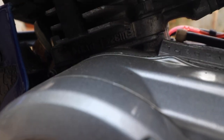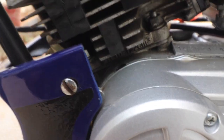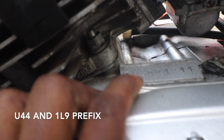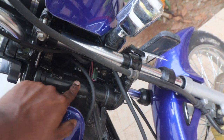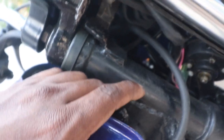To check if it's a converted bike or an original bike, the engine number for an original five-speed bike will start with 1E5 and I think 04-4 — those are the two codes that would confirm it is an original five-speed. Make sure this engine number matches the chassis number on the frame. If you look at the chassis number, it already has '98' written — so this is actually a 1998 model.